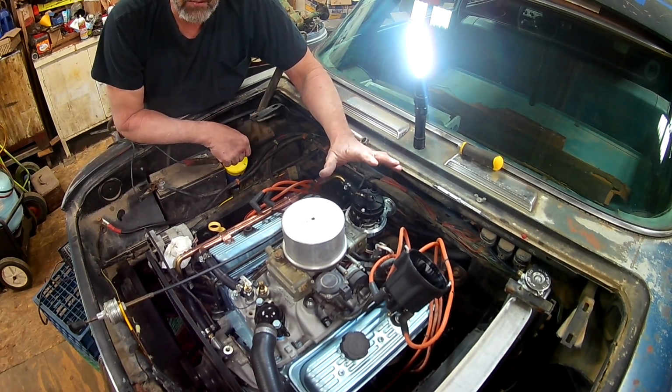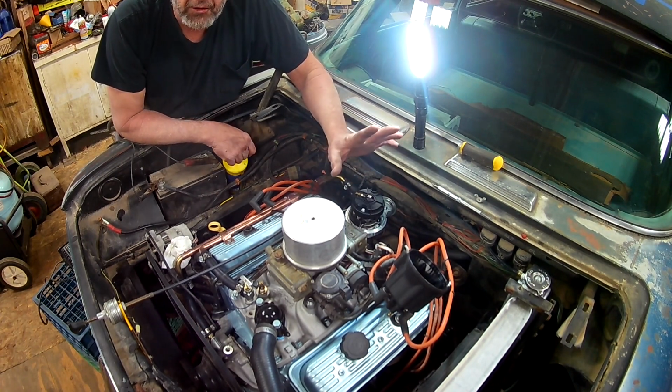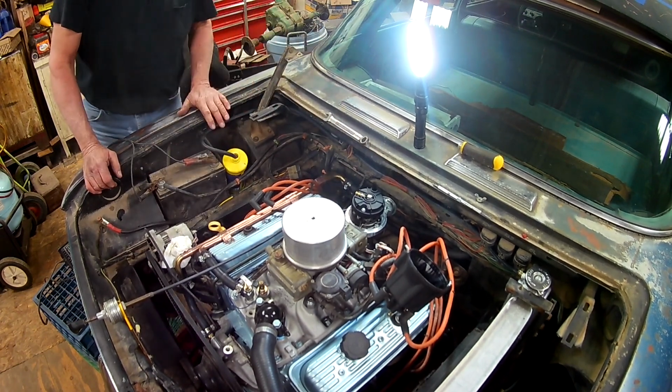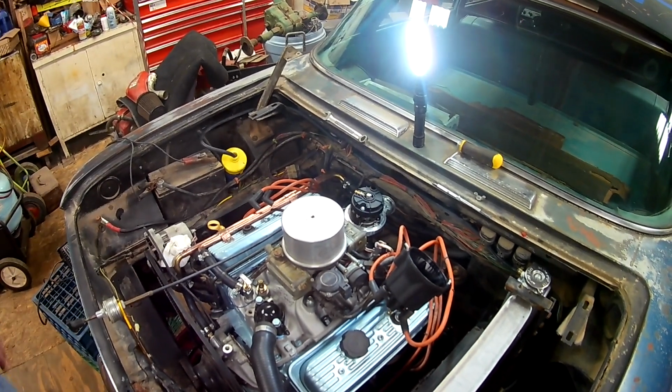And when I go to crank them up brand new, I don't have the ignition on. First off, I spin it up till I got oil pressure. Confirm I got oil pressure. Then we go into ignition and making her fire. There you go, one start.